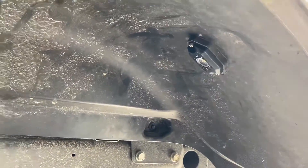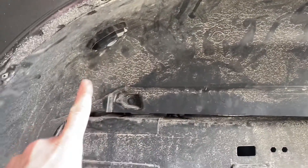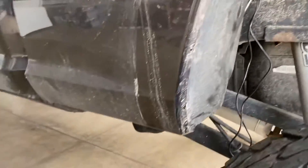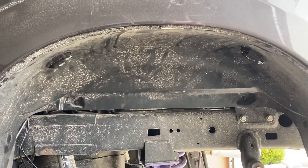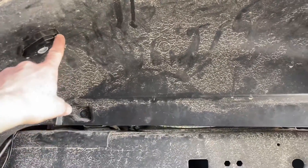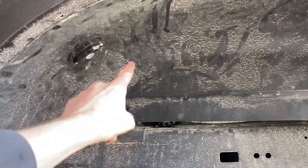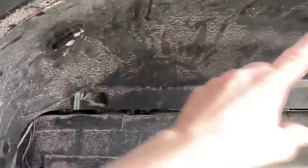Got the back one done. I have one over here and one up here, already mounted. From the back I zip tied the wires together and brought them down so they can run to the middle of the truck where the control module will go. For the rear wheel well liner, since it's not as deep, I did about 6.5 inches from the back lip measured in, to try to keep the lights as centered as possible. The spacing is still about 20 inches apart.